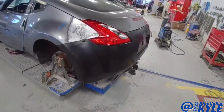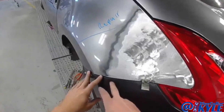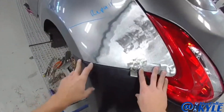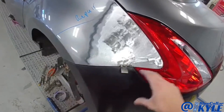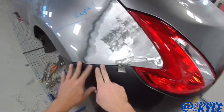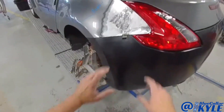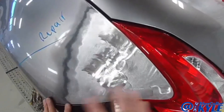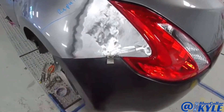I got this one all fit together and it's fitting up pretty nice. I'm probably gonna have to tweak this a little more once it's welded together. The problem is everything's loose — the bottom flange on that quarter panel is loose right now so I can't get it to stay where I want it to. But it's close, so I'm gonna go ahead and weld that extension on, and then once it's welded on I'll do a little more finagling right in this area to bring that out just a hair more.